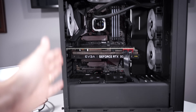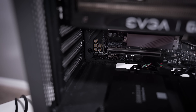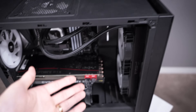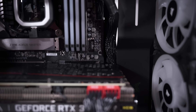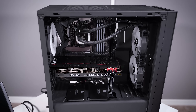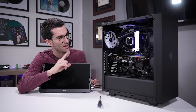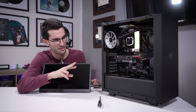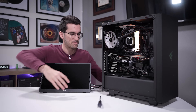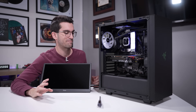We're not going to keep the system on long — we just want to see if that fixes any of the issues. I also noticed he's missing his HD audio cable and his USB 3.0 connection, which should both come with this case. There are some things to address after the fact. But even with only the 24-pin, 8-pin EPS, and two supplemental 8-pins for the graphics card connected, the system is still exhibiting the same symptom: lights turn on, but we don't actually get power.